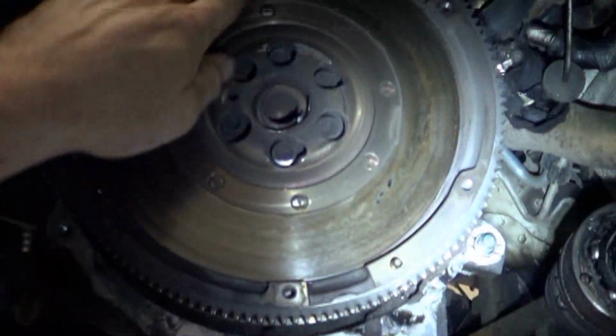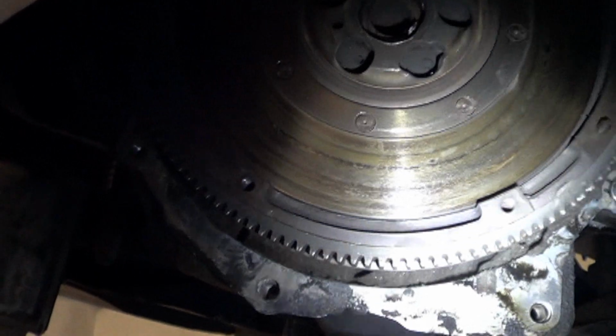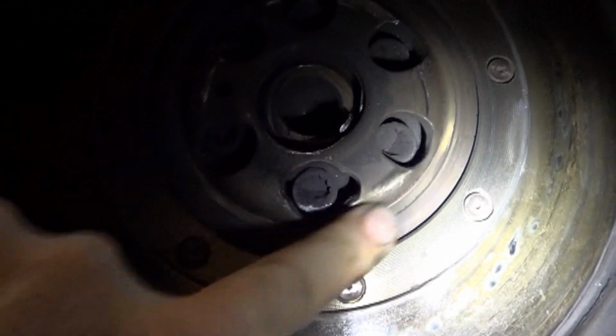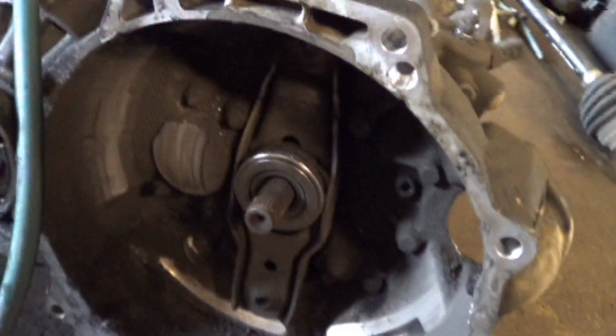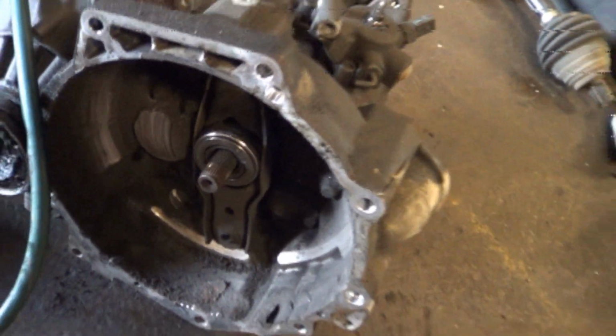We just pulled this clutch out of this Mark V TDI, and the flywheel is just absolutely destroyed. This is the worst one I've ever seen. You can just simply spin it. It's still bolted to the crankshaft, and you can just spin it. Good thing about that is we can get to these bolts easy. Don't have to cut the center out like we've had to do on some. But the bad thing about it is it allowed movement, and it rubbed against the trans. I think most of that is just cosmetic damage. You probably could still reuse it, but it definitely caused some damage.